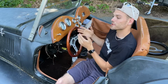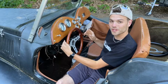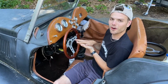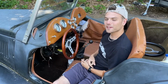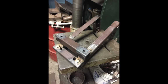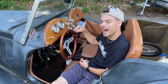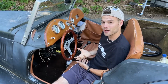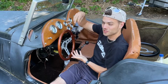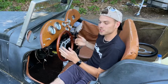This column is supposed to bolt up. And so therefore, the turn signal switch would be on the left and the key would be on the right, how you would normally start the car. However, I flipped it over because Tarpy MacGyvered me together a bed frame steering bracket that mounts to the fiberglass wall and holds in the entire steering shaft via the bottom. And so the steering column has to mount on the top and go down, hence why it's flipped. And the directional switch is wrong, the key switch is wrong.